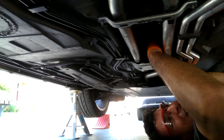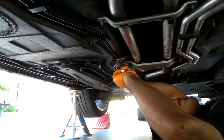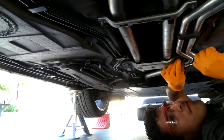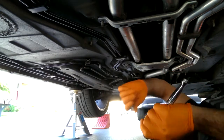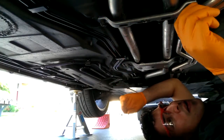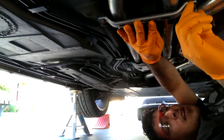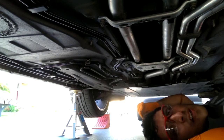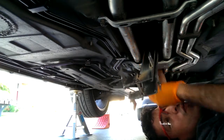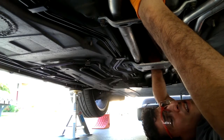I just can't wait for this AccuSump to just hang there and be secured. This is an E14, and then back here these are just a pair of 10 millimeter nuts. The other thing I haven't clipped in is the little vacuum line because it's soft and flexible in comparison to these heavier hoses. That's in now. What I concluded was: to get this with the sump attached, it's best to have everything bolted together outside of the car and then just raise it into place and bring the brackets up to it.